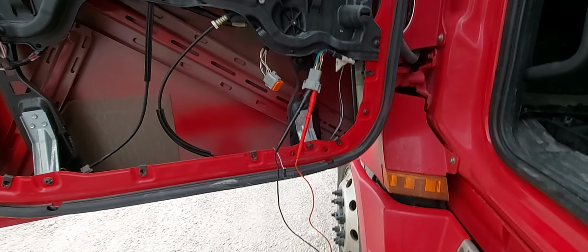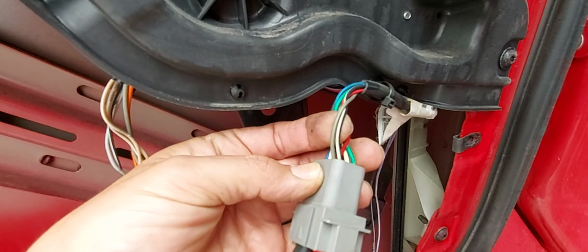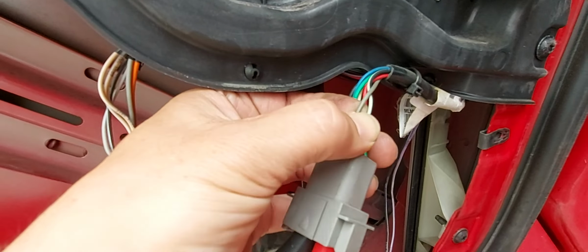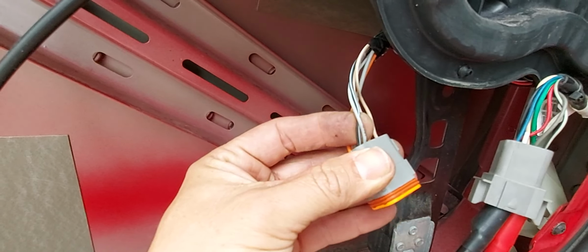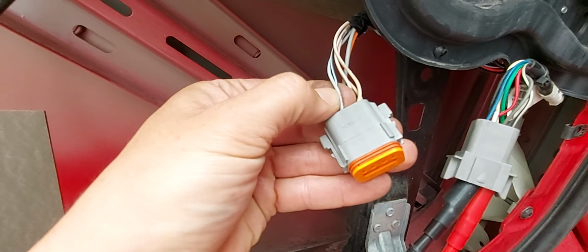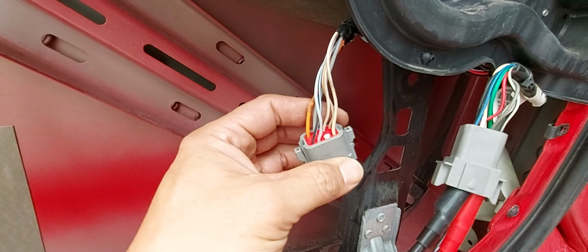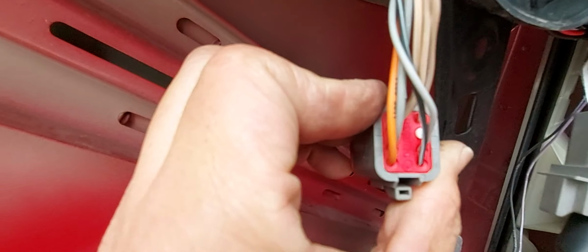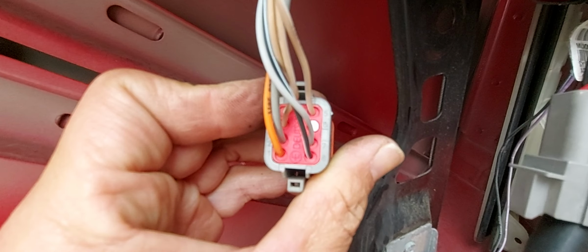if it was even possible. So, to recap, black wire with white stripe, gray wire on the mirror side of the connector, and then on the truck side of the connector, it'll be the same black with white stripe and gray wire. Pin 7 and 8. Will my phone camera work here? Too close, won't focus.